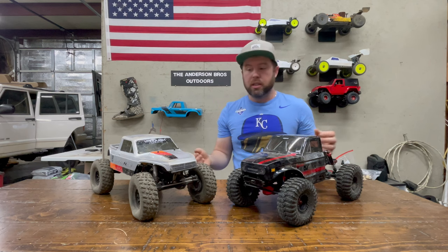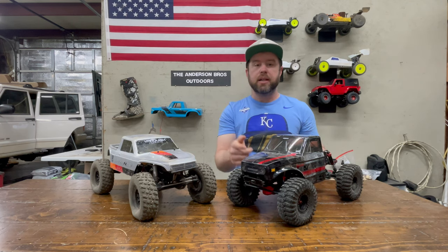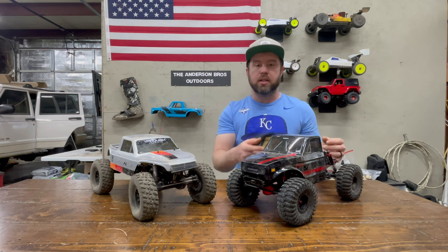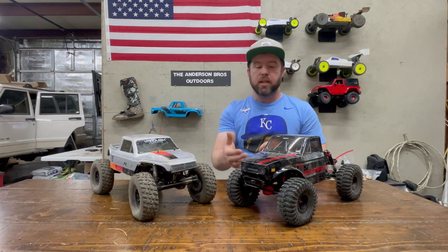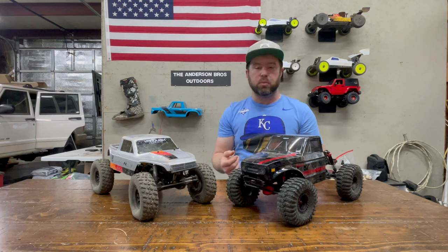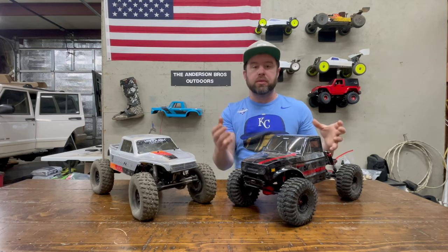It is pretty good. This truck is a flat rail chassis, 0-degree skid, chassis mounted. The rest of it is pretty typical. The other big thing is it does come with a Hobbywing Fusion SE, which is fantastic, by the way. The servo is really good. The BEC voltage right out of the box is 7.4 volts. So all in all, you do get a pretty well-rounded truck.